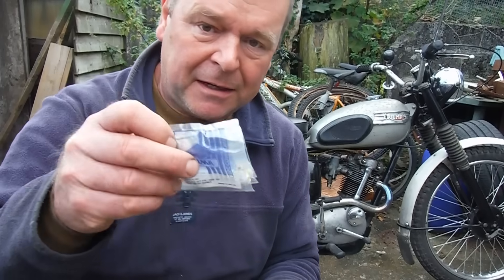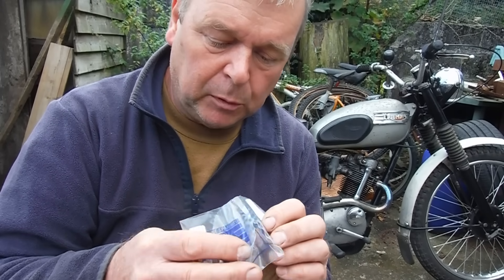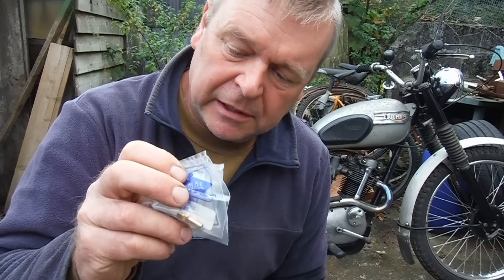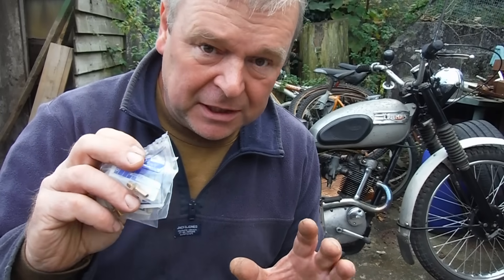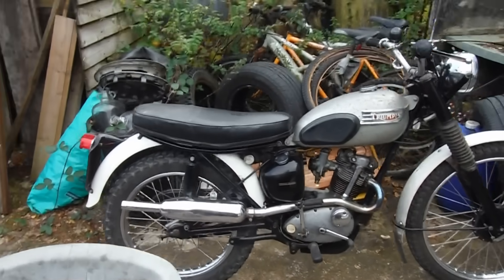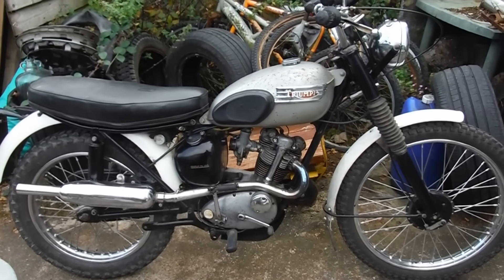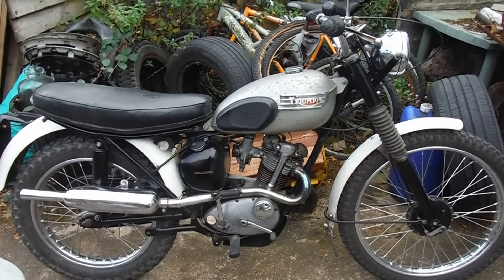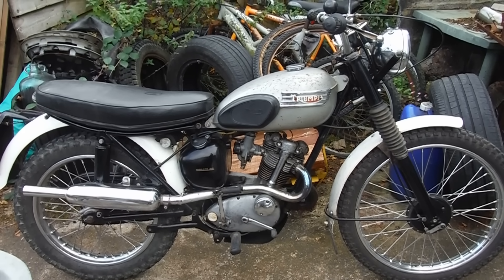I just wanted to highlight the fact that I've overcome slight glitches and flat spots and pinking by going up a size or maybe occasionally two sizes on needle jets in the carburettors. I have used 108s occasionally. I haven't had to touch anything else — haven't had to bother with the needle height or changing the slide or anything like that. Just going from one size to the next size up and it really can be a revelation. It's certainly done me proud on this little one and a couple of my own machines as well as various customer machines over the last few years. Why not give it a try? It certainly won't do any harm to go up a size. So thanks for watching.